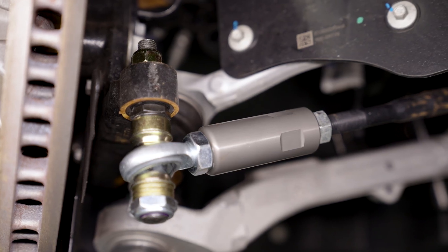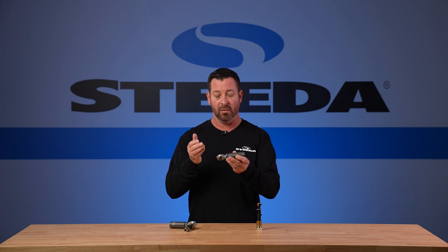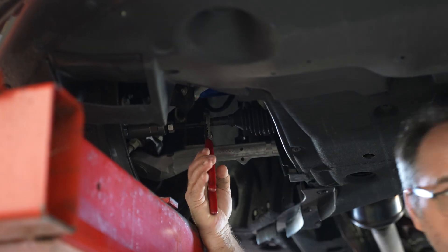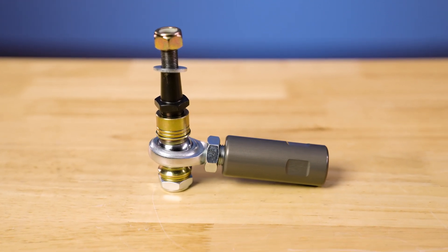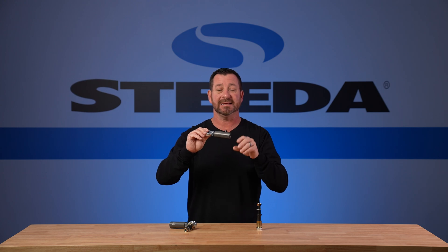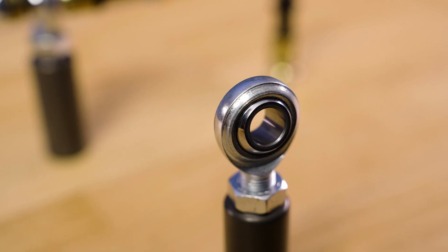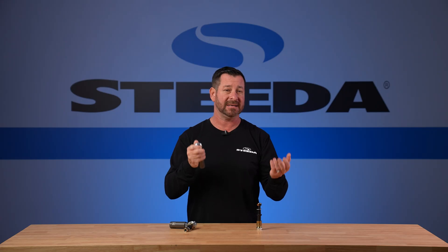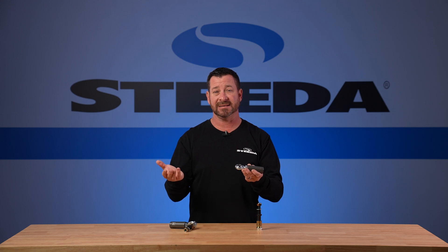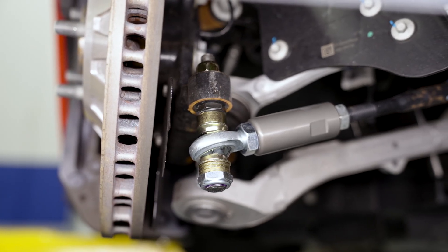As far as your tie rod end — what attaches to your steering rack — we start off with billet 6061 aluminum and drill and tap it with a left hand and a right hand thread, so you can adjust the length of this on the car. You'll see the wrench flats; we put those on a particular side to get them as far away from the wheel as possible so you're not dinging the inside of your wheels and you have the most room to work. We have a jam nut to lock in your adjustment and we use a high-quality domestic rod end that's teflon lined. That teflon liner is going to help keep it quiet and reduce any chance of NVH. Some other kits use a steel-on-steel setup — it's a more racy design but it's going to create knockback and noise. These don't.